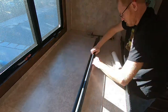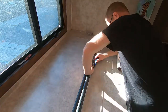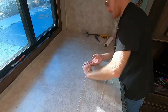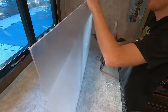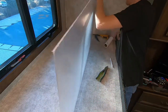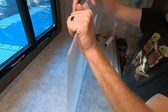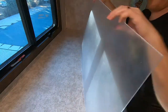I'm just using a plexiglass knife to cut it to size — scored about five or six times on each side, and then it just snaps off. I decided to make sure that the windows were a little bit safer by sanding down any of the rough edges or sharp corners. I think this is a 60-grit sanding block that I used; it worked out pretty well.